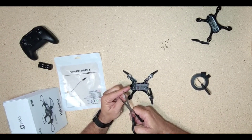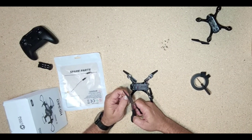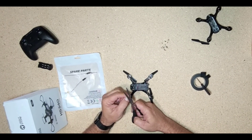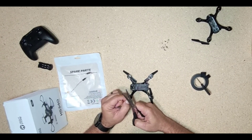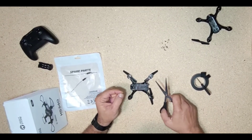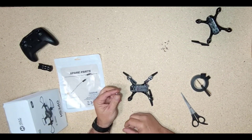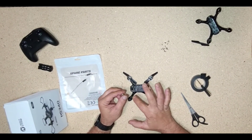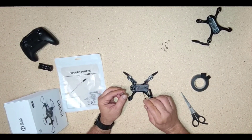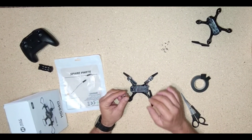Just rip it — there's the blue piece that came off, so it did strip. Just make sure you hold the lower part of this wire really secure so you don't pull it off the motor or the drone. Don't squeeze the scissors hard — just enough that you can pull it up and strip it. Now I'm going to try to do it with the length the wires already are, and I'm hoping we can just tuck it down in here with the screwdriver. We don't have a whole lot of wire to play with.